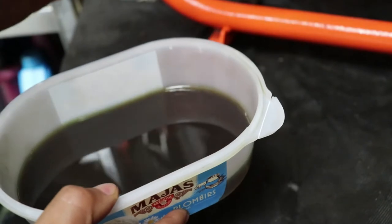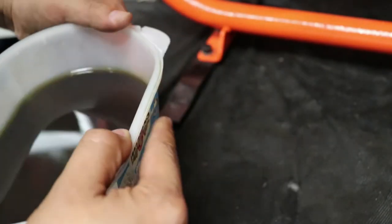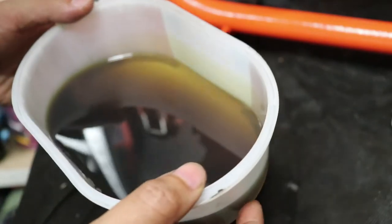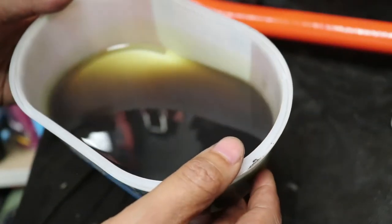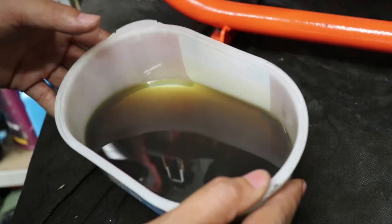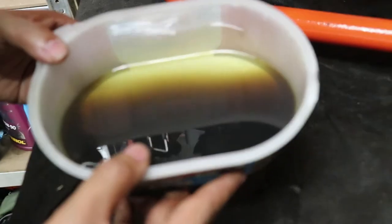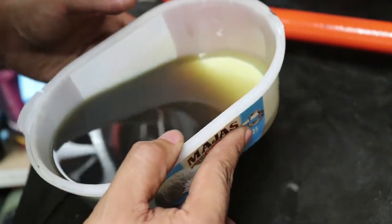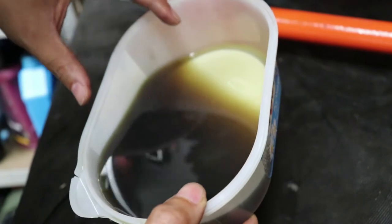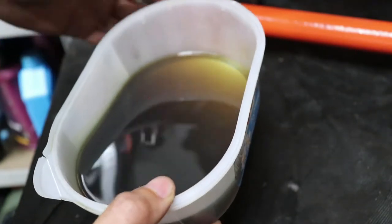This drain is at about 500 kilometers. I run very low mileage as I just ride around the city and I'm not doing any touring. So this is a good example of good used gear oil from a Vespa engine. You may see a little bit of shiny metal powder, which is normal for a Vespa crankcase to have sometimes.